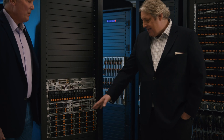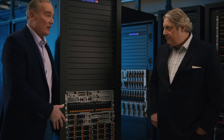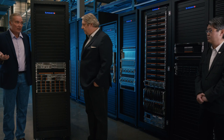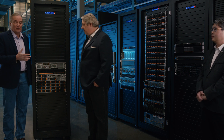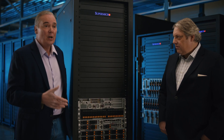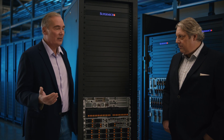It's something that has made it very popular and we're excited to take this one to market. We're also building in all sorts of new kinds of security. We actually have a hardware root of trust that's compliant with NIST 800-193, built right into the BMC. We have attestation where we're attesting to the security and validity of the product from the factory all the way to the end-user customer, and supply chain security with more products made in the USA than any of our competitors, all made right here in San Jose.